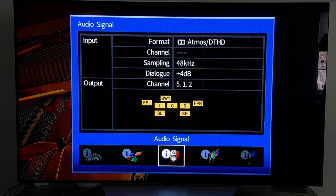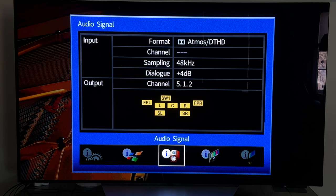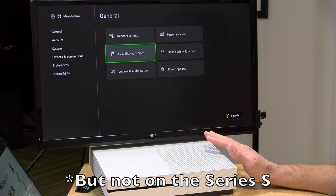I did want to show you what my receiver looks like when the Nvidia Shield is playing something back. What the Shield does is just pass the audio direct through to the receiver — it receives the data from the file on the server, takes the audio data, and pushes it right back out on the HDMI cable. If we look at the receiver you'll see we've got that TrueHD audio, Atmos is enabled, my speakers are all lit up and everything is working fine. That's why in our last video the Shield was still the top dog for this stuff. The Xbox is getting pretty close — it will handle the audio fine but is still having some trouble with the Dolby Vision side of things. Some viewers also pointed out that Xboxes have a 4K Blu-ray player built in alongside all the gaming functionality, so I think the Xbox is going to be a great Plex client in the very near future once the Dolby Vision thing gets figured out.